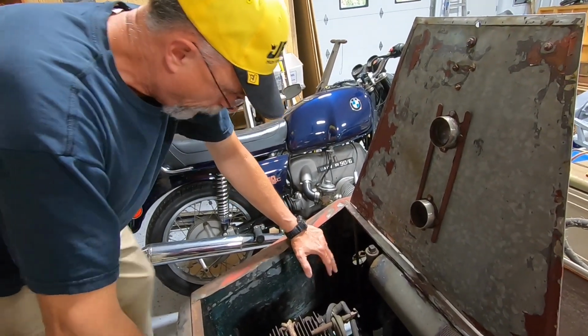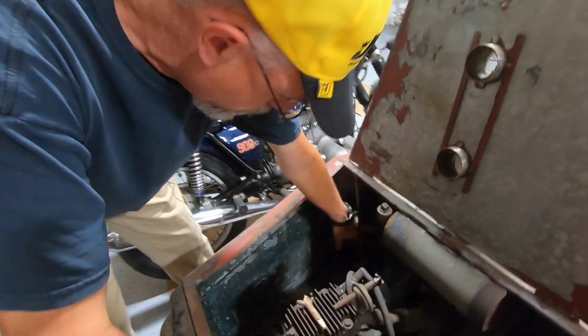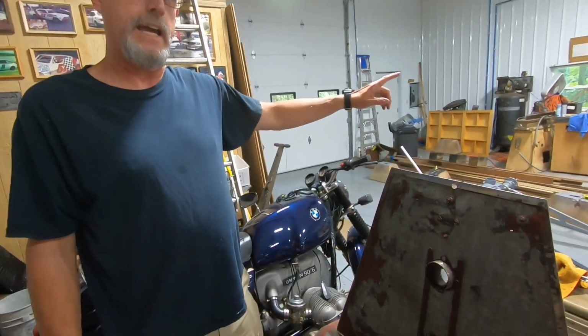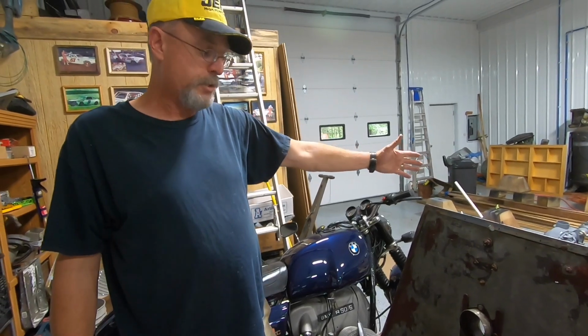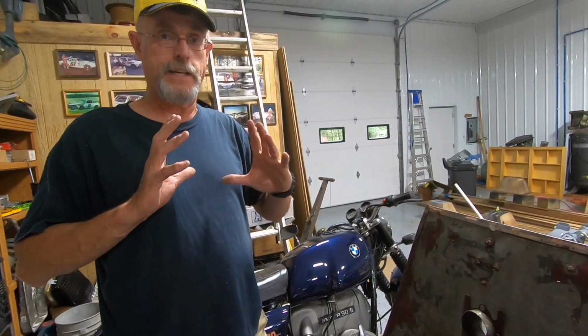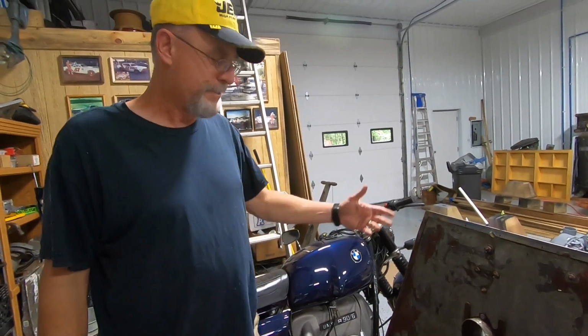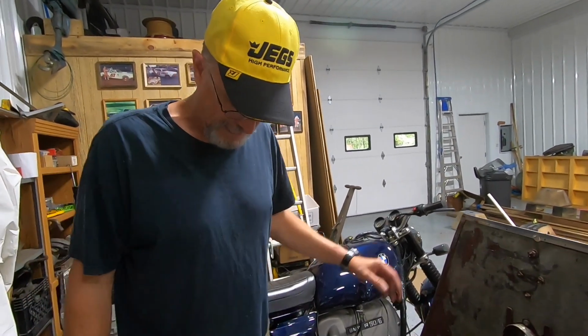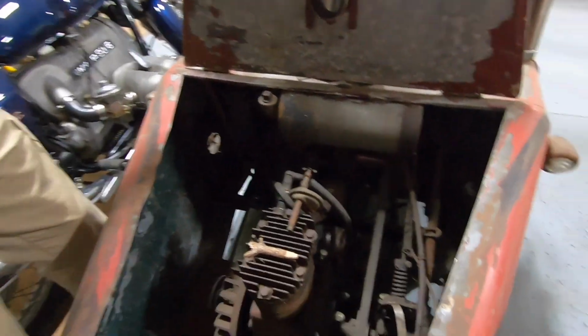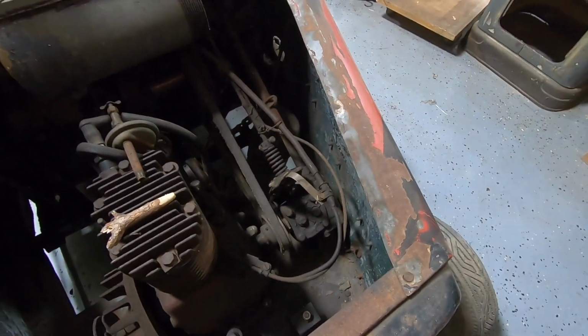Okay, then on the output shaft of the transmission, they welded a cog, which drives a chain back to an actual car type differential, which they welded another sprocket onto the side of to make the final drive on the thing. Steering box out of a 1930s car of some sort. We don't know exactly what it is.